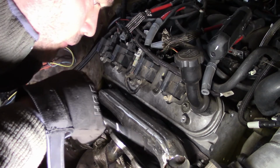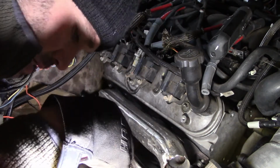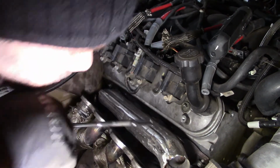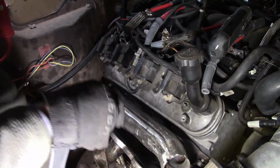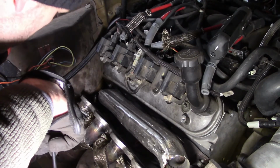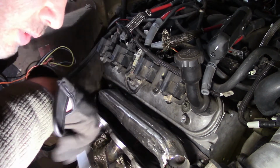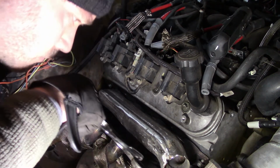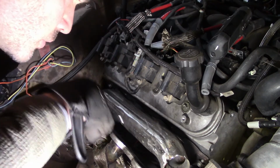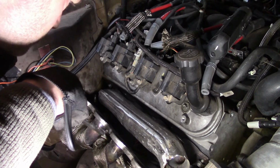So you know your welds are key, because the turbo is going to be supported by the manifold over here. I may end up having to make a bracket just to hold it on a little bit better. Could come off of a head bolt over there, or whatever. Maybe make a support for it because when the motor moves, your turbo moves. I'll use an adapter on the tubing so that it'll flex as well. But just stuff to think about. Your welds are key, because there's going to be a lot of movement. A lot of people don't think about that in the beginning, but that's really important.